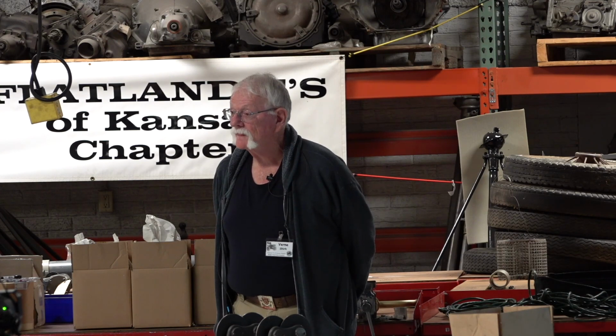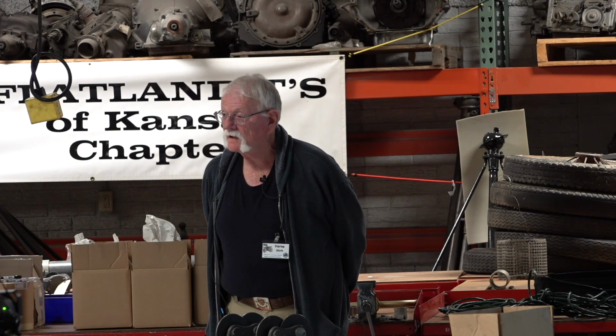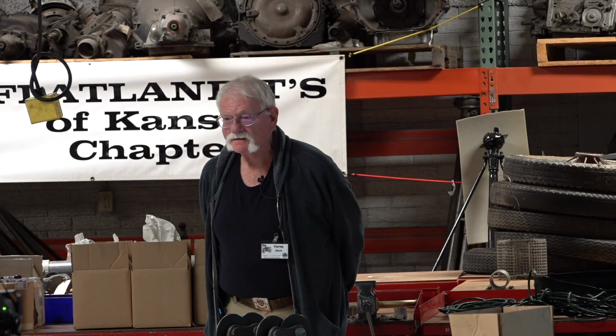I was wondering if you've ever found, in putting new brake linings on your shoes, are you finding them too thick and having to sand them down? Yeah. Uh-huh. That's common, is it? Yeah. This day and age? Yeah. Okay. That's what I'm saying. I wish I could find the drawings of that and know what that's supposed to be. I'm not sure anybody looked at the original drawings when we were making shoes. And, I mean, I've got new brake shoes that are 50 years old, that were newly made back 50 years ago. And you're going to have to do some work to get them to fit.